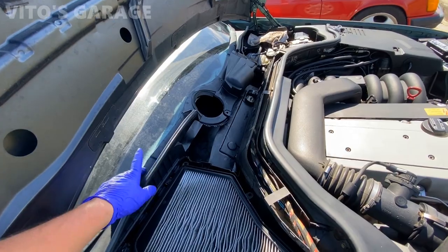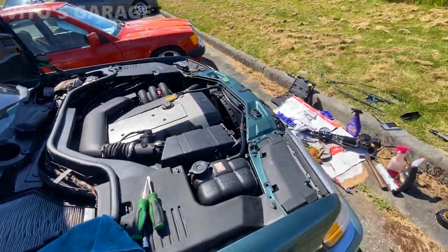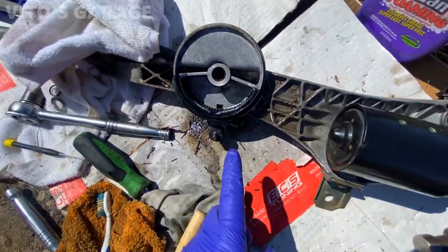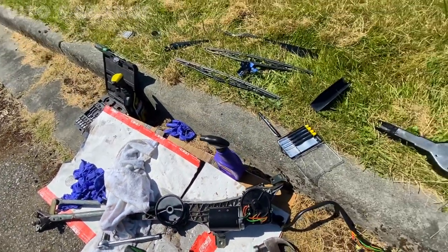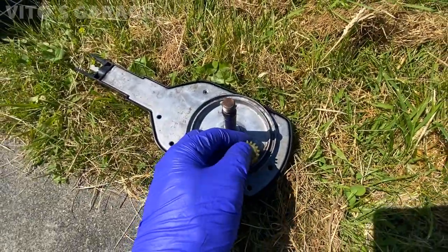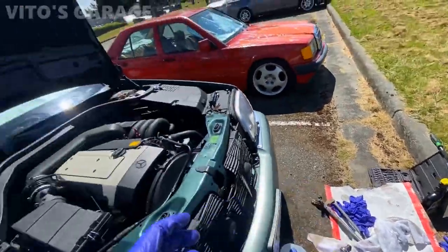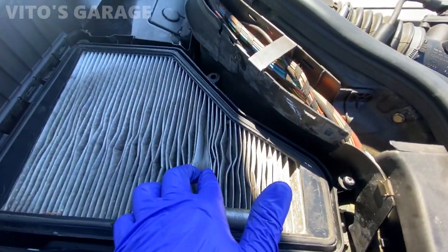This repair is going on hold for now. I'm loosely installing the plastic covers back without the wiper assembly. The wiper assembly itself is all cleaned up — the main gear teeth are perfectly normal with no broken teeth, which I'm super happy about. I've collected all the hardware into a separate bag. My goal now is to order the new gear, replace it, then proceed to reinstalling the wiper assembly. I'll also order the cabin filter.